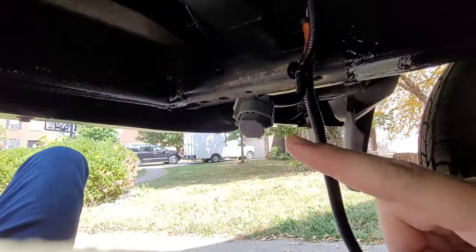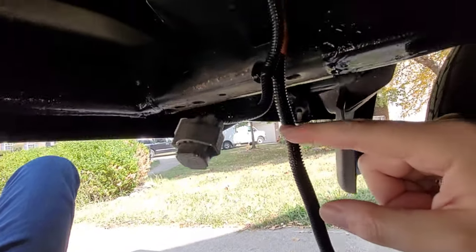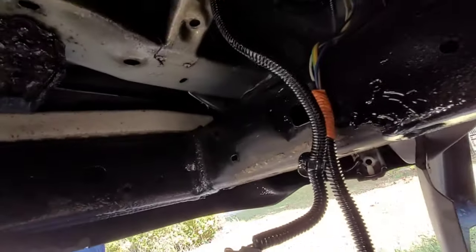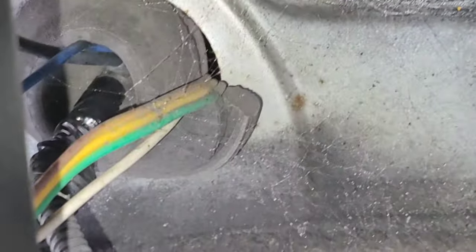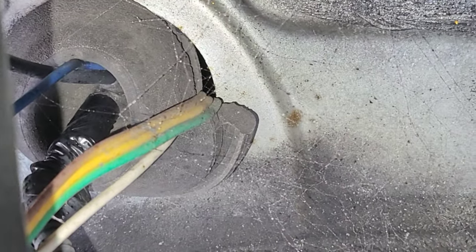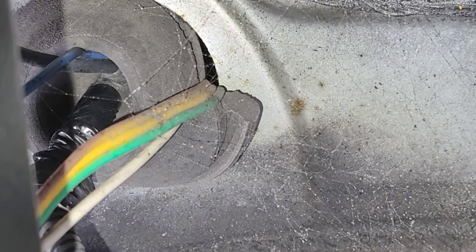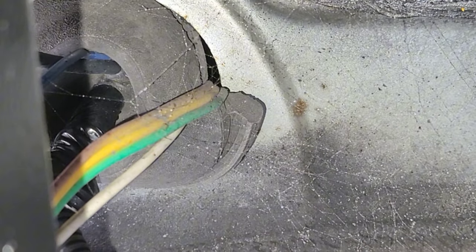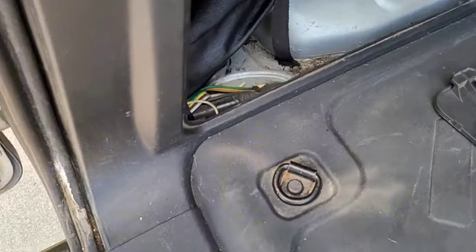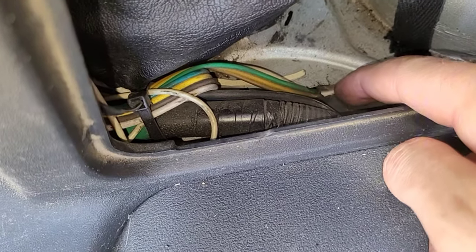Here's something a little interesting. This is the wiring for the Toyota. This monstrosity here is what whoever wired in that hitch used. Those wires are getting cut off between the grommet that seals and the body of this FJ — so this is a crap wiring job. I'll probably yank this out and put in the Toyota OEM product, so that'll cost me another hundred bucks or so. Here's the upper view of that wiring mess — wire is right up against these sharp cutting edges.